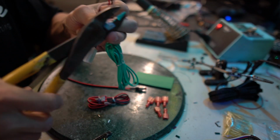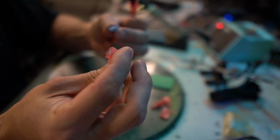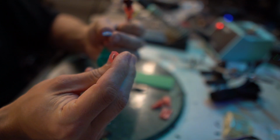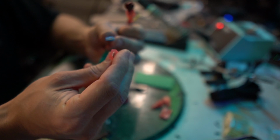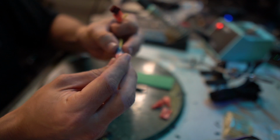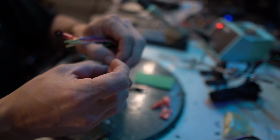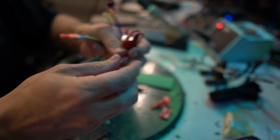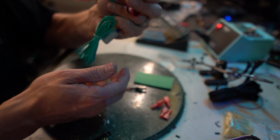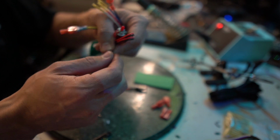Okay, so that's done. Now what we want to connect to the wire coming from the actual brake light bulbs is going to be this connector. We're going to cut that wire that's normally fed by the brake light wire in the car. We're going to cut it in half. One side, the one going to the bulbs, is going to connect to this male connector here. After we add this switch in there so that we can turn on and off power simply, what we want to do is put the opposite kind of connector so that we can always unplug all of this stuff and just plug the brake light wire where we cut it in half right back into itself. And then we can be back to stock.